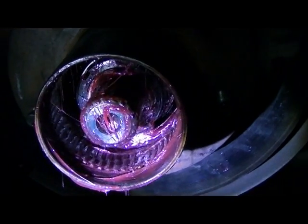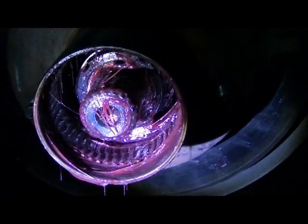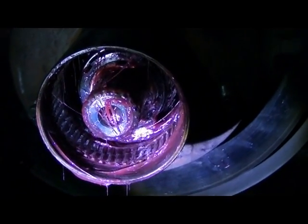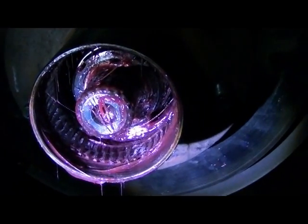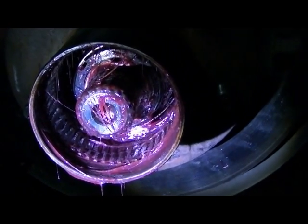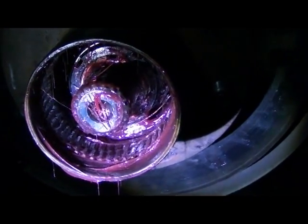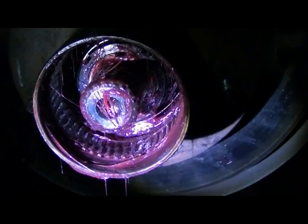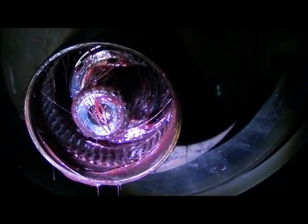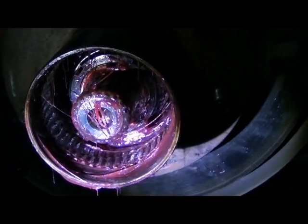Okay, so before I put the manual hub on, I'm going to go ahead and take some grease. I'm not going to go crazy with the grease, but you do want to have some grease in there. I know the mile marker says do not pack their part with grease, and I don't put any grease on that, but the inner parts of my manual hub I do. I put a slight to decent coating in there. You don't have to pack it, you don't have to go crazy with grease. Just get some in there. Basically what it was when I pulled it out.